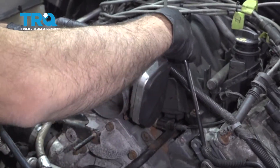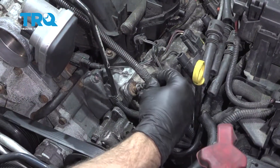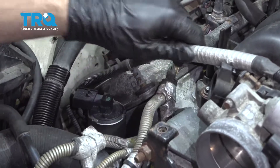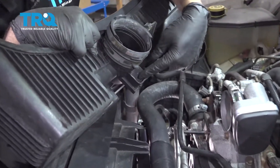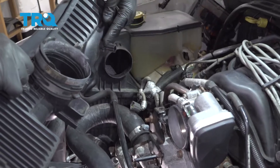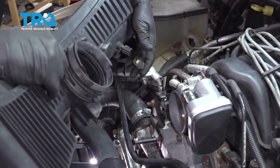Don't forget to hook up your vacuum tube right here, and put the little tabs on — there's one here and one on the other side. Now install the air box: there's a metal post that inserts into the bottom part, and there's also a connector for one of the intake temp sensors, so go ahead and get that connected.